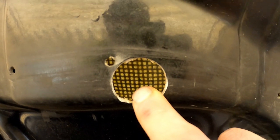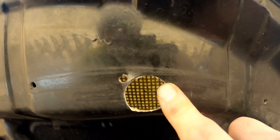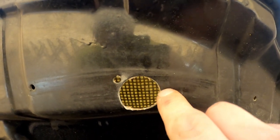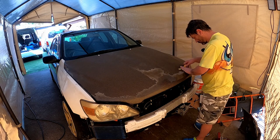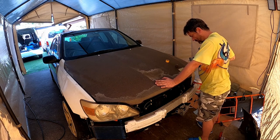What I'm going to do is drill that mark out with a small drill bit, and then drill in from the top with the hole saw in this size. Afterwards, after I know that it all locks in, I'll come back and mark the edge of this so that it's bigger, and grind it or cut it out so that the nut fits in there. I'm going to repeatedly open and close this a million times until I know that I'm in the right spot. There's our little hole and I can see the pin. As scary as it is, it's time to drill the hole, which means I need masking tape.